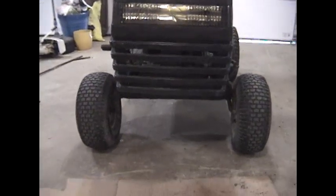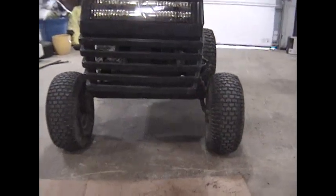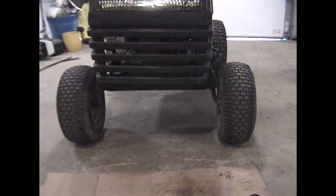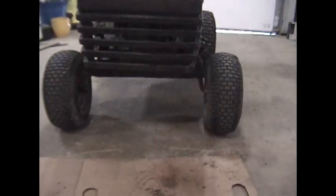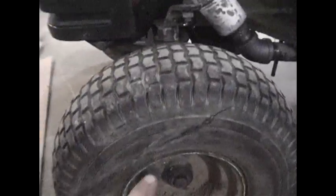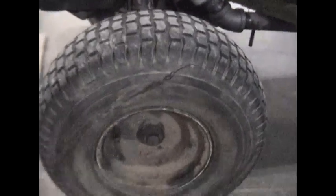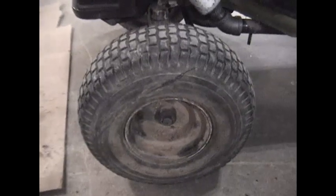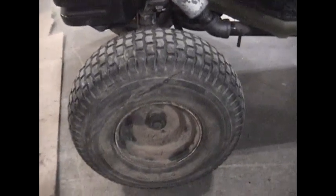The other thing I'm going to do eventually is get tires. That tire was off the rim and flat, and it had a big cut in it. Here's something for you: if you're ever messing with mowers and you've got a bad tire, you don't have to replace the tire - even with a big slash in it like this one. Just buy yourself an $8 inner tube instead of a $25 tire. It works great - that's a little trick.